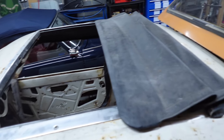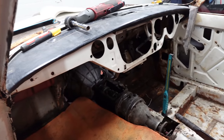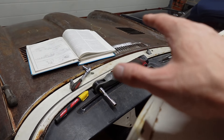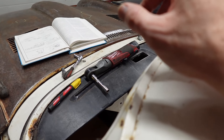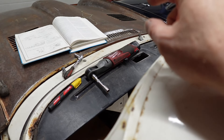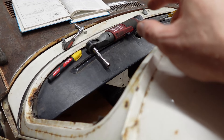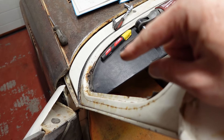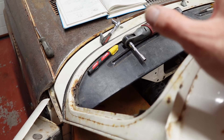So this morning I'm trying to figure out this sunroof and how it comes off. I've got all the wiring out - the front and the rear - everything's clear from behind the dash. Most everything in the engine bay, but I've left the master cylinders, the wiper mechanisms and things like that, just because they're not going to get in the way too much or suffer too much. It's mostly the glass and the trim I've been concerned about. I'm not trying to remove the dash top because to remove the dash top I need to remove the windscreen, and I don't want to remove the windscreen until I've had a chance to check on the shape of the body and potentially stabilize some bits of the windscreen surround - the other side particularly - because there's enough metal rotten or been taken out that I don't want to risk changing the shape.